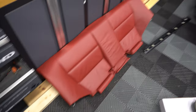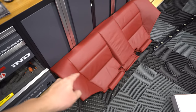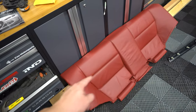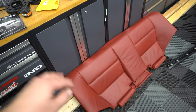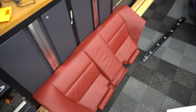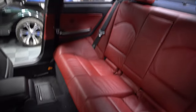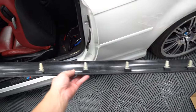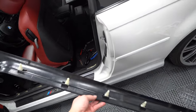Put this piece back on — it's going to sit right here. Pull the pin out first and then squeeze this as you are putting it back in. This holds it down into place and you can re-align this little piece and it just clips right back in. Put that seat back into place and reinstall the T20s. Last pieces of the puzzle are the rear seat bottom and the little door sill trim piece — this just goes right back into place, finagle it back in, push it down. Rear seat is back in. Go ahead and reinstall this piece and we're good to go.